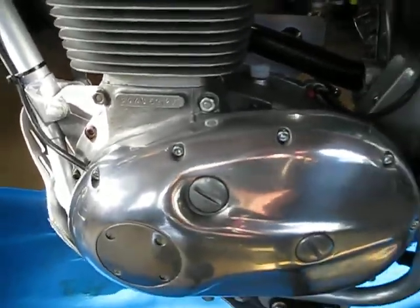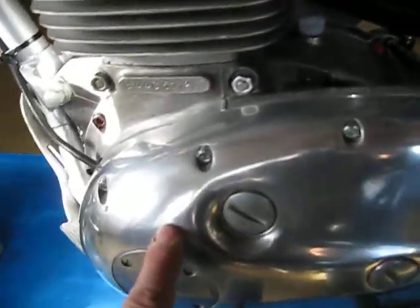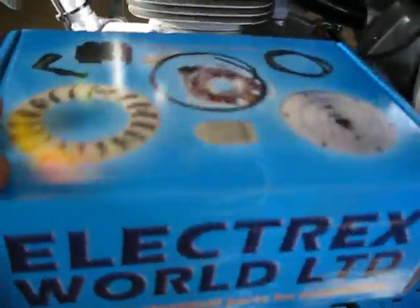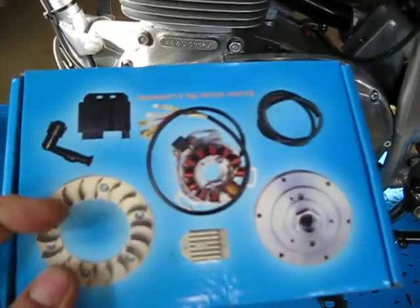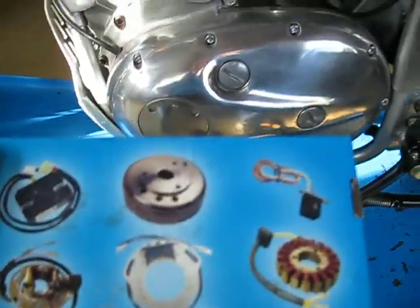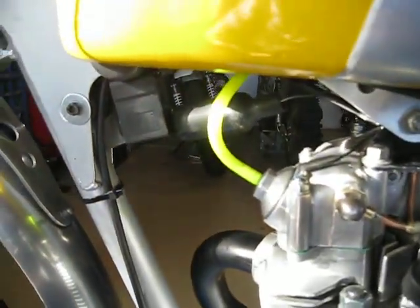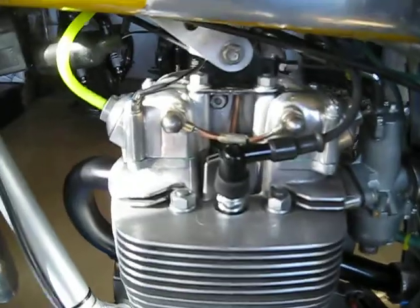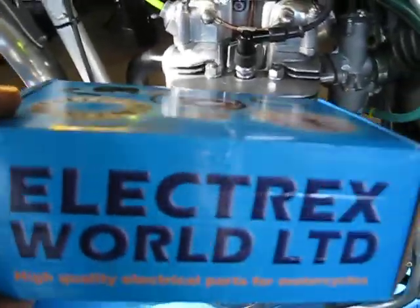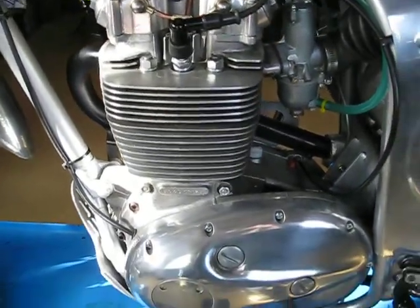This is a B44C motor, 1969 — numbers match the frame. I do have an Electrex electronic ignition in here; that's for stand-alone. Electrex is made in the UK. It is an internal rotor design, just like stock, with just a sending unit. It goes up to a combination CDI coil box, and there are literally two connections in this entire electrical system — gets rid of all the old stuff. These Electrex units are for race bikes, something you're not going to need lights on because they don't have a charging/lighting circuit. It's strictly ignition, but it's now all solid state.